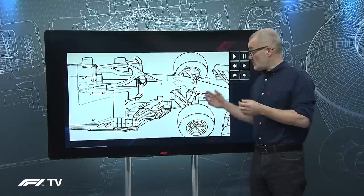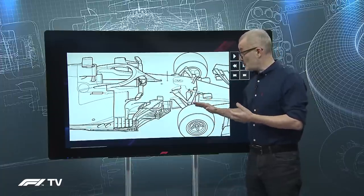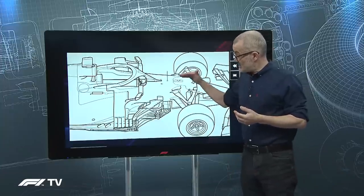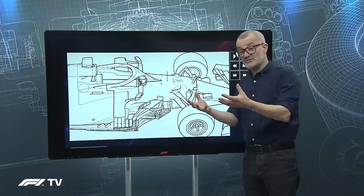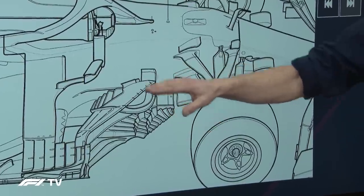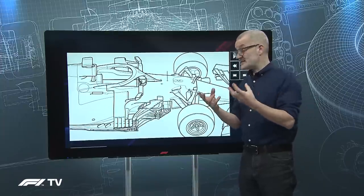The outwash effect is well known, but what the teams and aerodynamicists have discovered is that the downwash effect is even more important. As airflow rises up from underneath the front wing around this area of bodywork, they want to turn this airflow down — create downwash — and this does two things. First, it creates downwash around the side pods to push airflow over the floor to the diffuser, creating higher pressure on the diffuser and more downforce. That's achieved through horizontal vanes here and around the side pods, just pushing airflow down. But there is an unseen function of barge boards, and for that we need to look underneath the car.